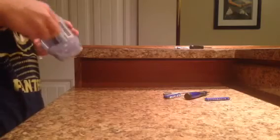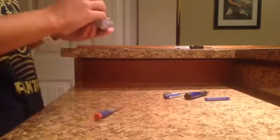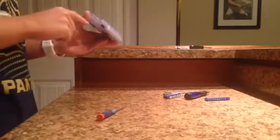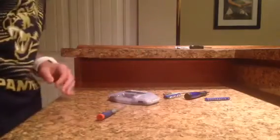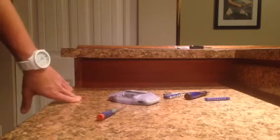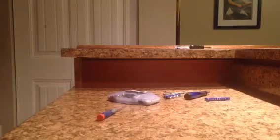It's a longer screw, so that'll take a bit longer to screw in than the other ones you just did. You're going to have to kind of push it because this one is going to be a rough one to get in. And if you have a clear one, mine is kind of clear, you'll be able to see inside and see if the screw has reached the other half, and also you can try to pull it apart. And then you just put in the last 6 tri-wing screws, which I'm going to put in off camera because people might complain about it, so I'll be right back.